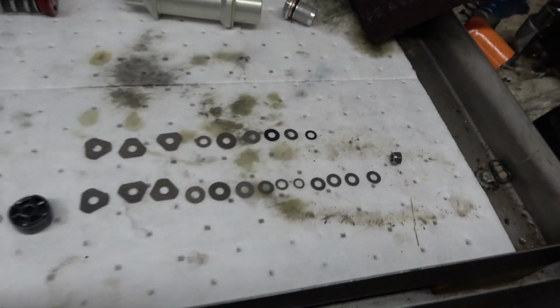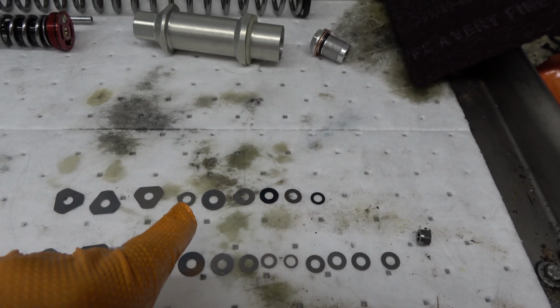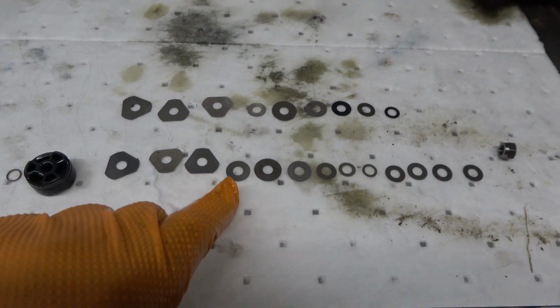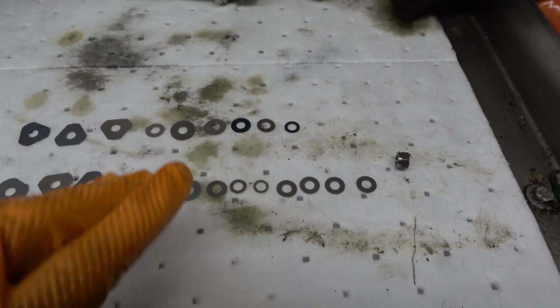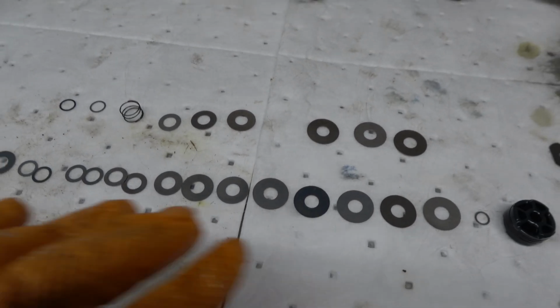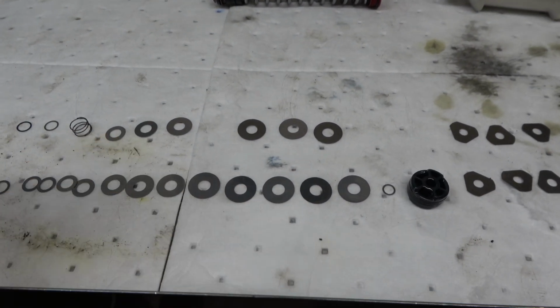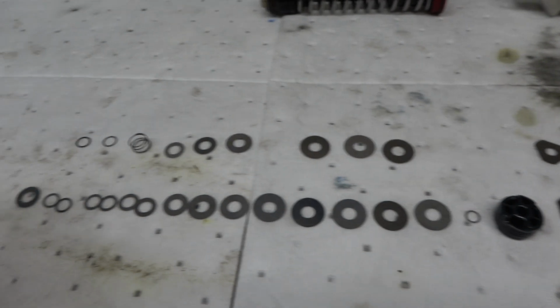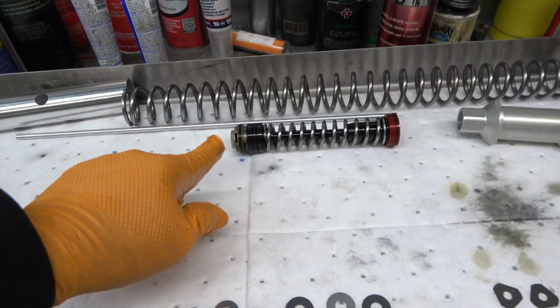There's crossover stuff here. You can see we've got even a little bit of rebound crossover here, diving way down and coming back up. It's a smaller difference. And then they go back down and come up here for another crossover and rebound. We don't really do that over here on our stack. The compression on the mid valve doesn't have a crossover. So let me get this all installed onto there, and then I will show you the main compression valve here.